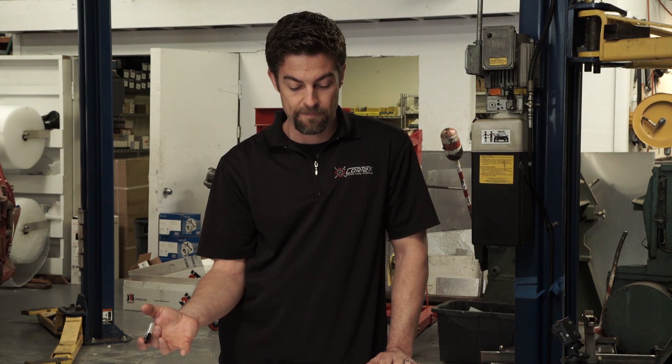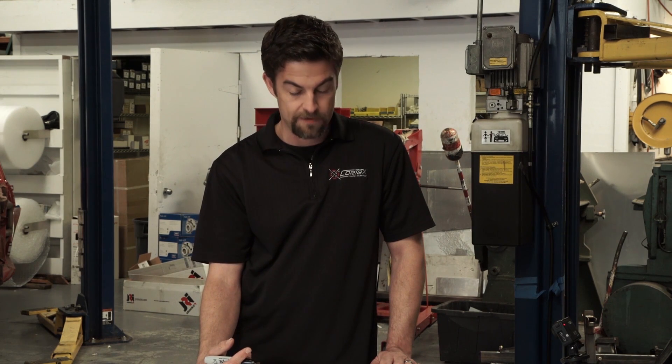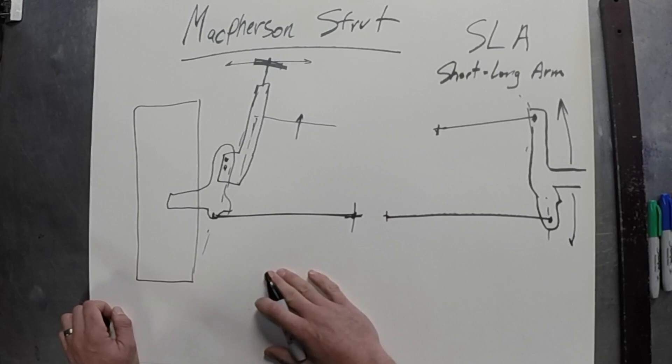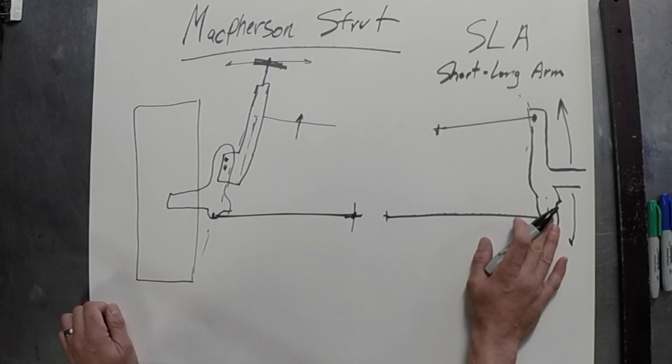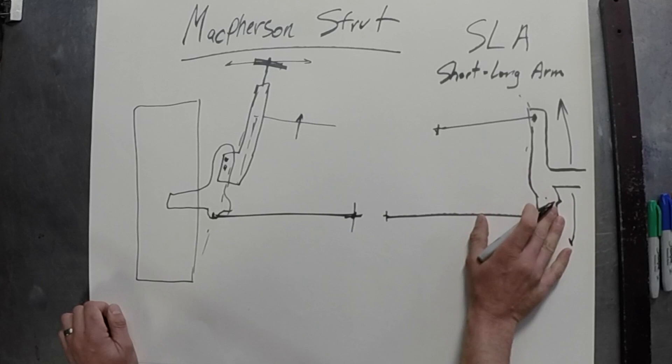What's the disadvantage? It seems like you could just set your camber angle to what you wanted before you started. And that's essentially what we're doing on race cars, and it works relatively well. But today's tires like a lot of camber — especially radial tires — upwards of three, four, five degrees. If you set a lot of static negative camber, the car is probably not going to brake as well because the tire will not be flat to the road in braking zones. You can still set a relatively high negative camber value, but not as high because as the body rolls and the suspension compresses, it's going to gain more camber. So if you set the SLA at three degrees, you'll probably have to set the McPherson at five to accomplish a similar goal.